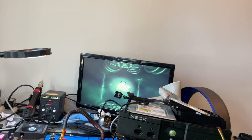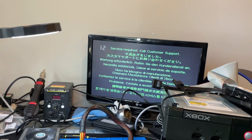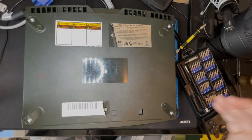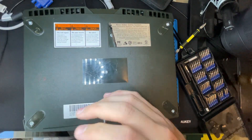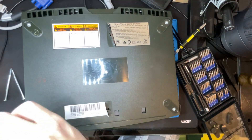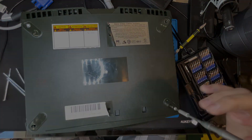Or if you do want to go ahead and do the extra work it takes to install a mod chip. So this video today is going to be covering all of that. The long story short is the easiest way to do this, if you already have a working hard drive, is to simply soft mod it. With a soft mod you'll be able to replace your hard drive as well, as long as you can get your original master hard drive key and back it up. Preventatively is probably the best way to go about this because a soft mod is a lot easier than the hard mod, but I'm going to show you both today.